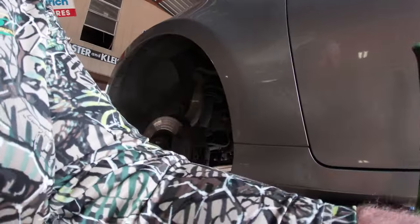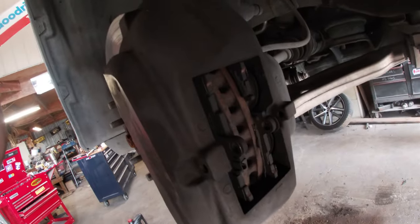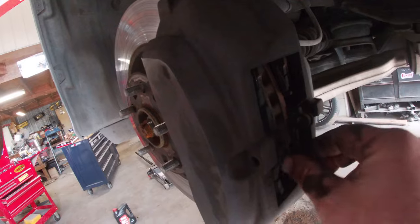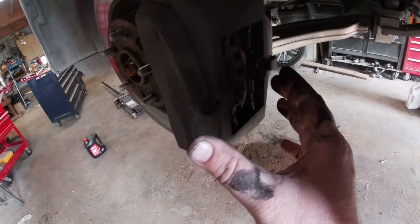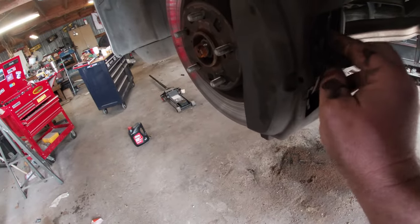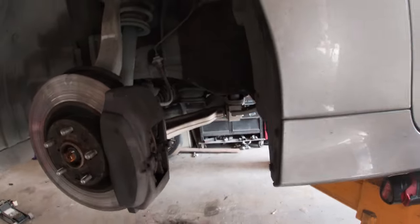By design these are like those old quick-change racing brake pads — they're supposed to be able to just come out right now. But they don't want to come out, possibly because of all these grooves and the way they're wearing. So what we're gonna do is move around to the back. We got a 17 millimeter down low and 17 millimeter up high. We're gonna take those two caliper bolts out and then wiggle this whole thing out as a unit.